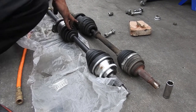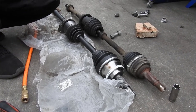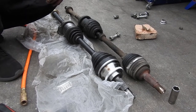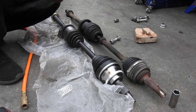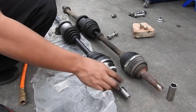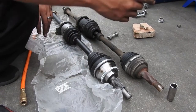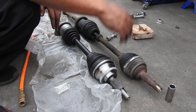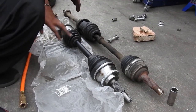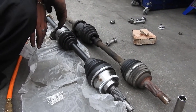I checked and they say the GT and GTS axles are the same, but I noticed this one is a little longer and I had a struggle taking it out, so I'm not sure if it's actually for this car. The only difference is this one's a little shorter, and this one has ABS — these are the teeth for the ABS sensor. It doesn't really matter if your car doesn't have ABS, but if it does and you put in an axle without ABS, your ABS light is always gonna be on.